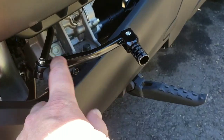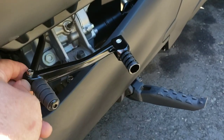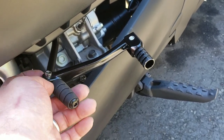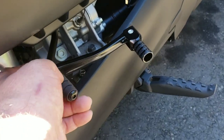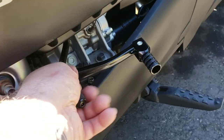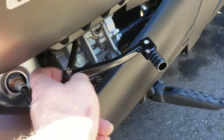It's a very easy modification to do and easy to explain. I'll leave a link in the description to purchase the shift lever — I believe it's about 10 bucks. It goes over the wider part of the bar; when you pull the rubber off, it's skinnier underneath, and this goes over that wider part. I took a Dremel and just ground down some of the teeth on it so it doesn't mar up the actual lever on the Ryker. Then we slid it on where we wanted it.